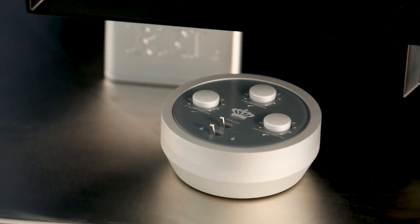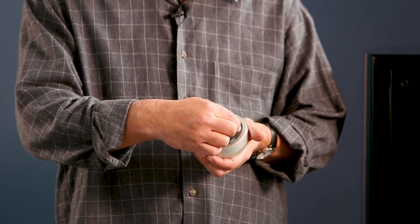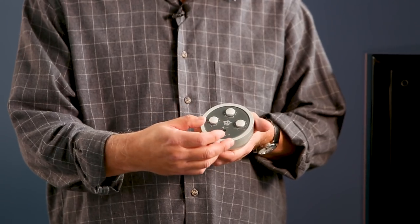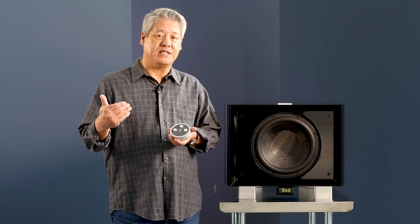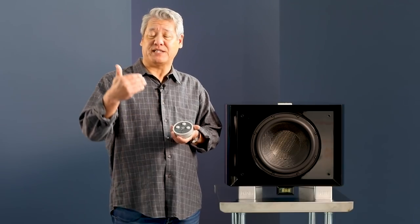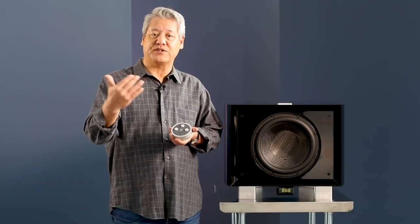The G1 Mark II has a lovely remote control that was designed just for this unit. We offer all the controls that would normally be on the rear panel, and we do it in such a way that it feels exactly like rear panel controls — beautiful individual detents for gain, for crossover, for point-one gain. We also allow you to adjust phase from the listening position, because phase at the listening position can be a little different than it is in other places in the room. You'll immediately be able to identify which direction — 0 or 180 — is louder; the louder direction means it's coupling with your speaker, and the opposite direction cancels bass.